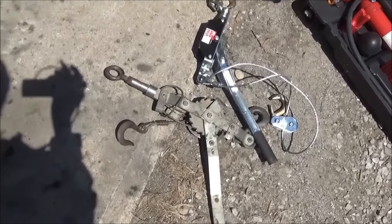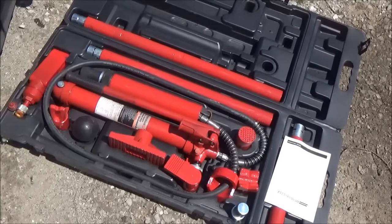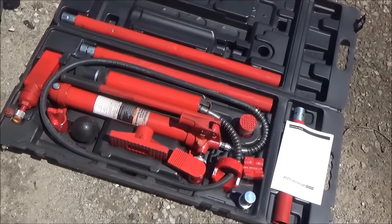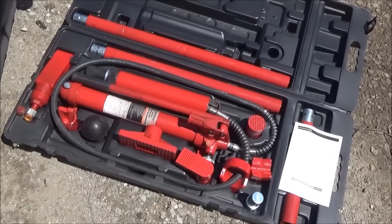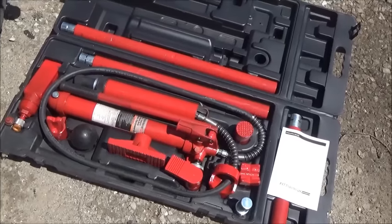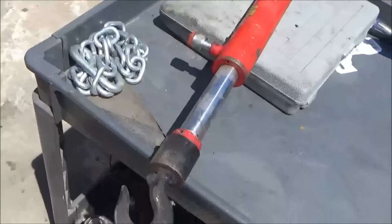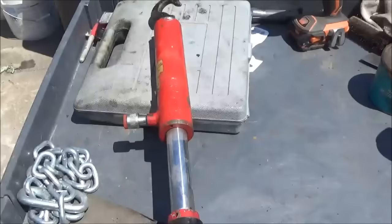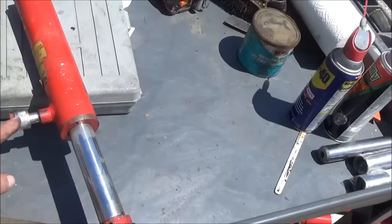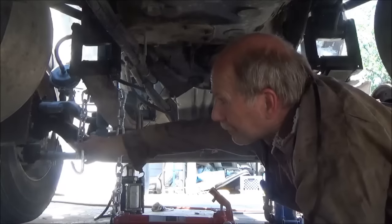Today, I'm going to use a port-a-power, and here's my new port-a-power kit, my old one. The pump went bad, and I couldn't get it fixed, so I couldn't buy a new pump alone without spending an extravagant amount of money. So I went to Harbor Freight and just bought a 10-ton kit from them. New pump and a bunch of new cylinders and stuff, but these kits do not come with the pull cylinder. The pull cylinder is one that relaxes and opens up, gets longer, and then when you pump on it, it gets shorter. I've got these chains down here wrapped around each end